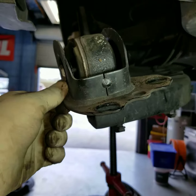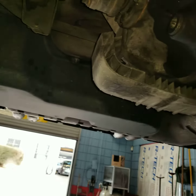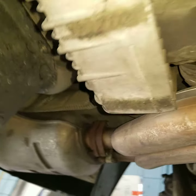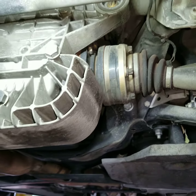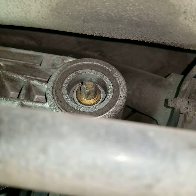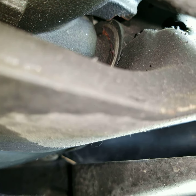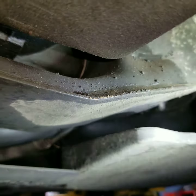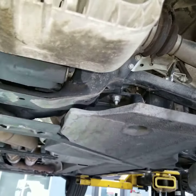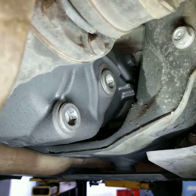This makes the car very unstable and not fun to drive. I'd also like to show you what it does to the other components of the vehicle, which is what most people fear — this is why we like to get the car in and inspect it. Those are the differential mounts. The two in the back are not too terribly bad on this car, but the forward one right in there is completely torn through, because the differential is moving around far too much and having this kind of play.